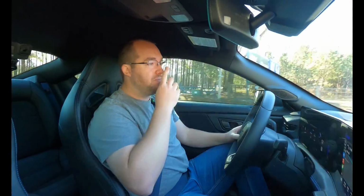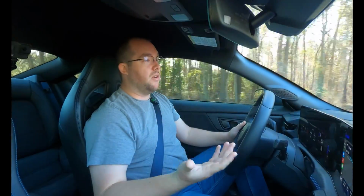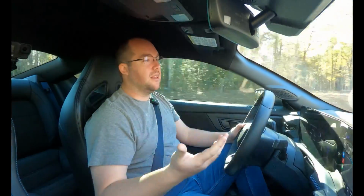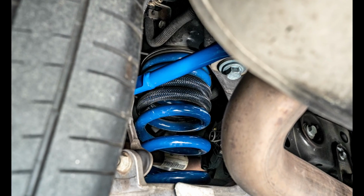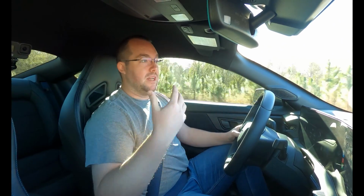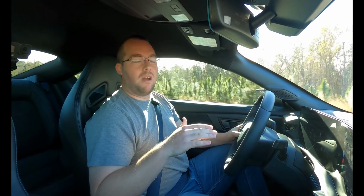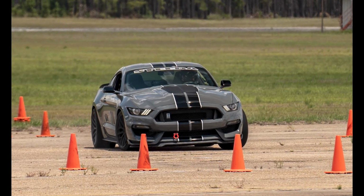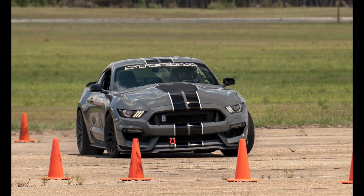And if you're a road course guy or a handling guy like me, you factor in a great spring that complements MagneRide, like Steeda's MagneRide dual rate springs, and it brings it to the next level, because those springs specifically are tuned for MagneRide, and you'll be able to get even stiffer, keep the car more planted as you're going around corners without as much roll because of the stiffer spring rates on those secondary rates, but you can even take it to the next level.